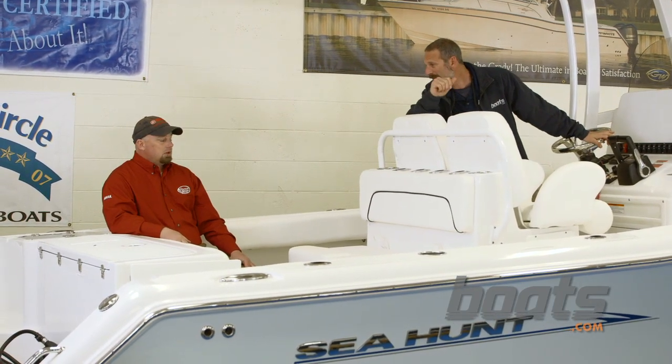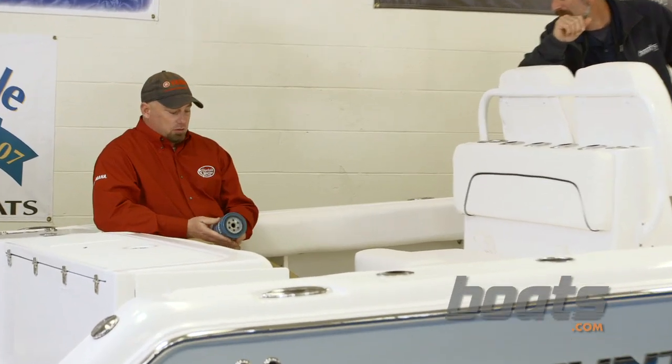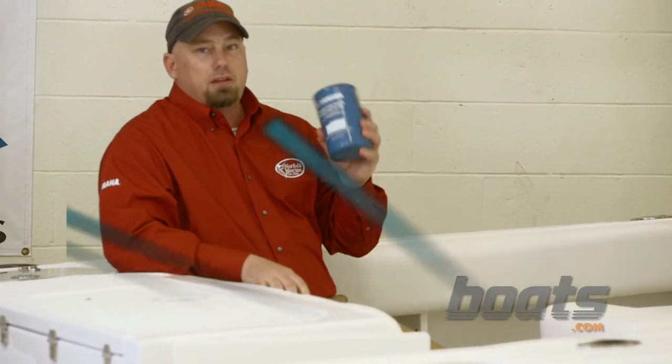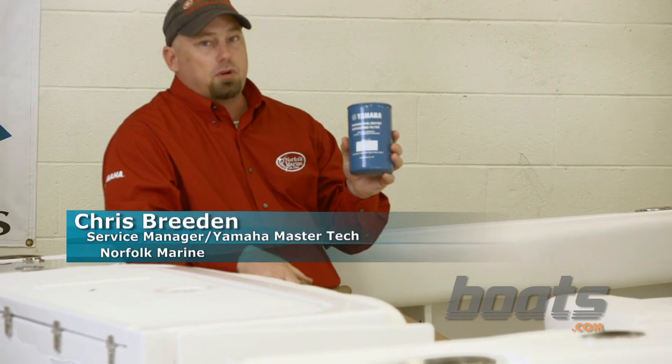Chris, what is it? Well, the biggest issue would be the fuel system and primarily the ethanol. One of the best things you can do to combat that problem is use a good high quality 10 micron fuel water separator filter. Now, what about fuel additives?